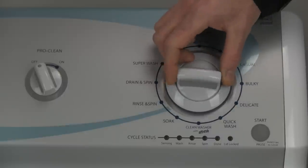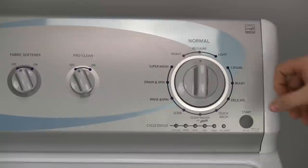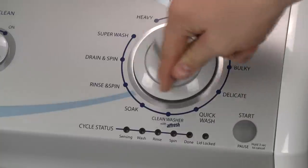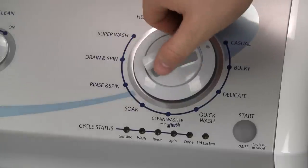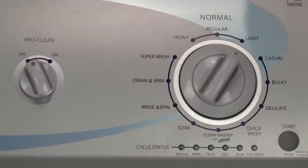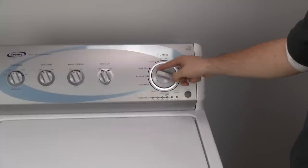Let's start with a very important process of understanding the diagnostics mode. Think of this as a combination lock — you clear to the left, three to four rotations, and then start the combination. Pretty quick: right, right, right, left, right. Each click should be slightly faster than one second. If you got it right, all the lights on the status bank should start flashing. If not, clear to the left and try again.